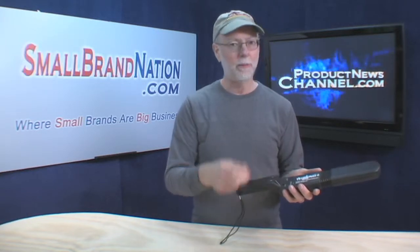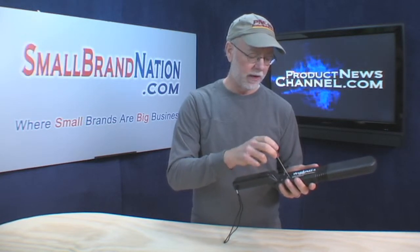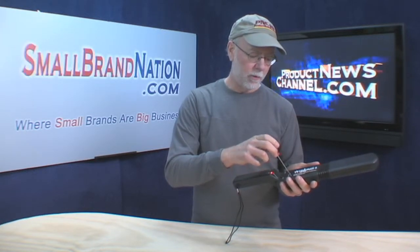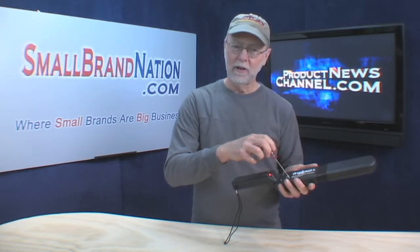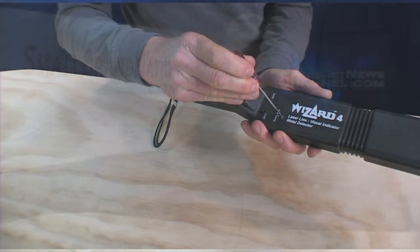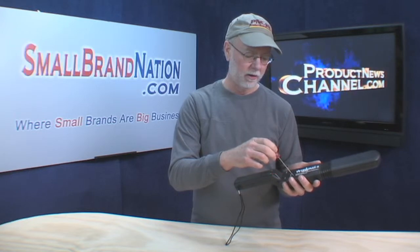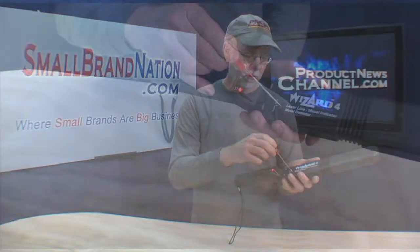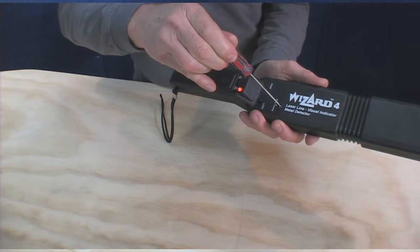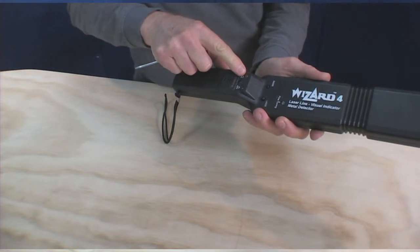Right now it's perfectly tuned, but normally if it needs tuning, it's going to beep all the time or it won't beep at all. In that case, you take your screwdriver and just rotate this little screw — like right now it's beeping all the time. If we turn the screw all the way to the left, it continues to beep. If we start backing it to the other direction, to the right, we want to be right on that threshold. Sometimes you have to play with it a couple of times to get it right on the threshold. We'll put it about right there, and you'll notice that the red light flashes one time and that green light is flashing about every 4 seconds.